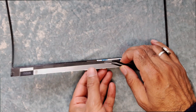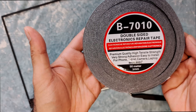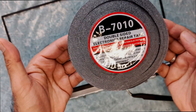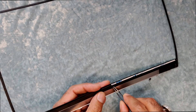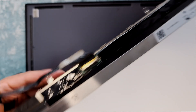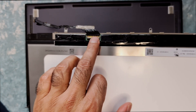I bought this double tape from Amazon for around £7. It's called B7010 and seems to be good quality - 50 meters and 3 millimeters wide. Just make sure the new screen you buy is correct and has the connector on the right side. This particular one had the connector on the left hand side and also had 30 pins.